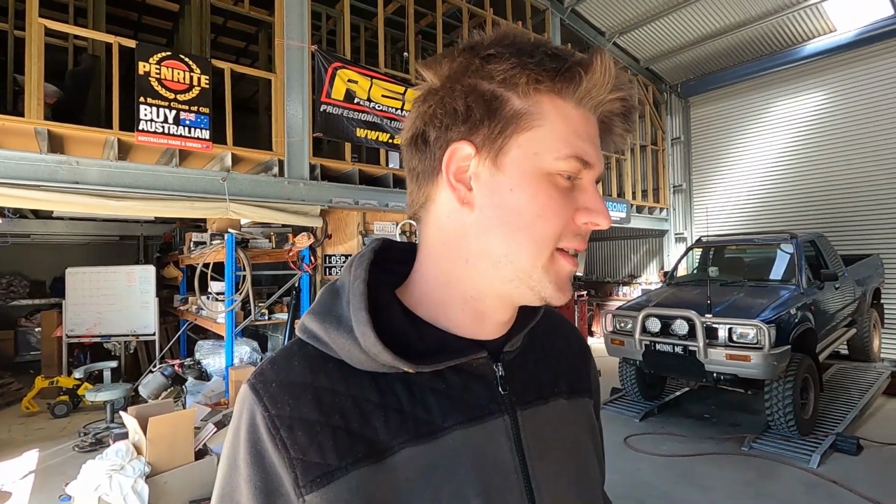Honestly, I'm really looking forward to it just as it sits. Really, really big fan of this cam. We've got the Crow Cams 1250 in this thing, which is one of my favorite cams. Nice long tube, 4-into-1 Pacemakers with a 2.5-inch exhaust, OTR, all of the berries, these hand-ported 243s. We're excited to see how this thing's going to go.